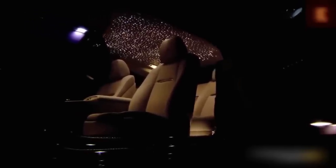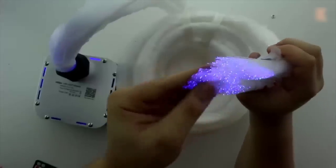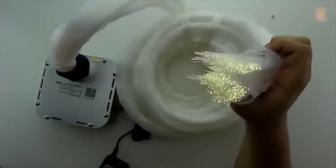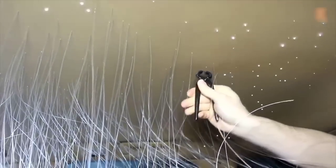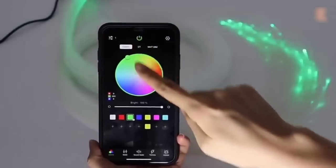The starry sky ceiling is not a new thing and today such a ceiling can be done in special services on any car, but the price is still not cheap. If you want such a ceiling you can do it with your own hands; for that, AliExpress has a ready-made set consisting of a beam of fiber optic filaments and a special unit that emits light. To install you need to remove the ceiling trim and pull each thread separately — the more imagination you have, the more beautiful the ceiling. Lighting control is done with a remote control or with an application on a smartphone. On the product page you can choose sets from 200 to 500 strands, and read many different reviews with installation examples.